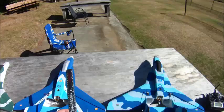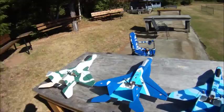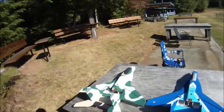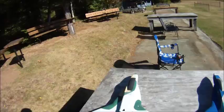This one's not quite so bad — it's about half an inch ahead of stock. So you can probably see a trend there. If you build one, don't be surprised — I know these are altered in the back end so that changes around maybe the center of lift and center of gravity a little bit. But don't be surprised — this is stock and I've got my C of G three quarters of an inch ahead of what the stock is per the plans. So if you build one, especially with KF4 airfoils, don't be surprised if your C of G ends up forward.